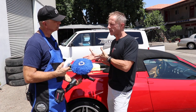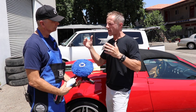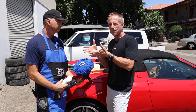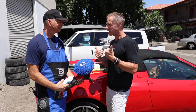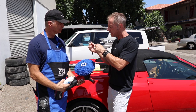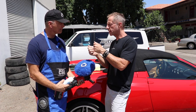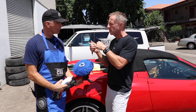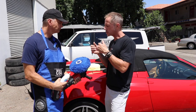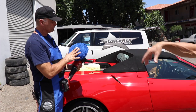Most of you won't want to work in direct sunlight because it's always easier on a shaded cool surface, but I want to show the versatility and unique factor of this product line. As a mobile detailer that means something to me. In the body shop world you go counter to the detailing world — as a beginner you never go up on an edge — but Tom says you can accept working on an edge to do the heavy lifting and then finish it out.